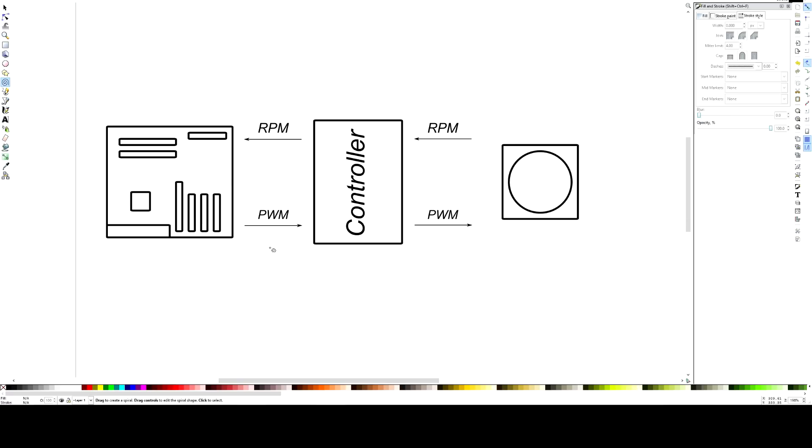Conceptually, what you have with this controller is: you have the motherboard on the left, you have the fan on the right, and you have this controller in between — and for all intents and purposes, this is just the microcontroller. The motherboard sends out a PWM signal signaling how fast the fan should work, the controller modifies this in some way, and then the fan turns at a certain ratio and outputs the RPM signal. The controller modifies that in some way and outputs an RPM signal to the motherboard. So from a hardware perspective, the obvious way to design this is to set up two ways to measure the PWM and the RPM signal, and two ways to output PWM and RPM signals.